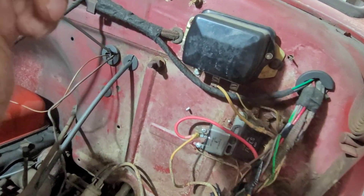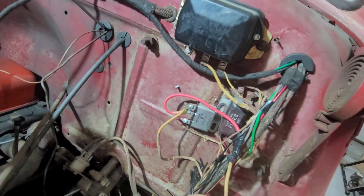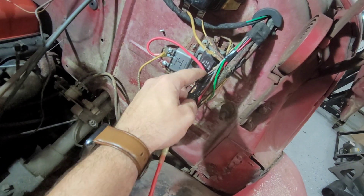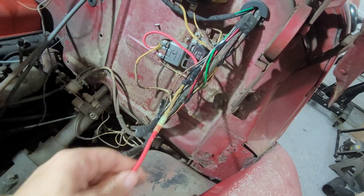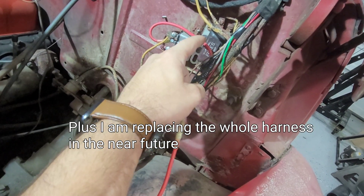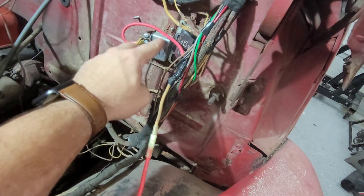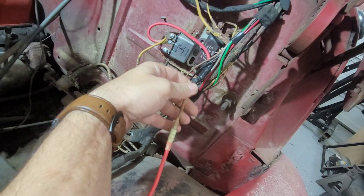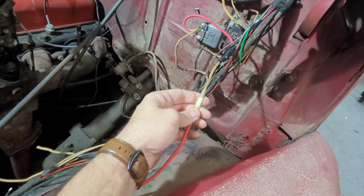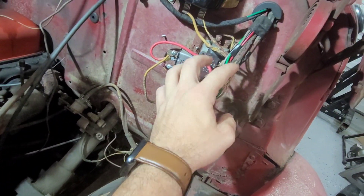Back underneath the truck - that's exactly what I did. I took the wires off the battery terminal. This is our armature and field wire, and what I did was pull them off and splice in a 10-gauge wire. That 10-gauge wire runs all the way down to the alternator. And that's where that horn relay wire comes off, right into here. That's all the wiring you actually need to do - it's incredibly simple. I have two splices because I didn't realize I needed this wire to come off here into the horn relay. But if I was to do it again, I would just splice them all into one location, have the 10-gauge wire run here, one going into the horn relay, and this goes all the way back to the amp meter like we showed you in the wiring diagram. And again, that's all you have to do. If you wanted to not have splices in your wires, all you have to do is put a 10-gauge wire on here and run it all the way back to the amp meter.